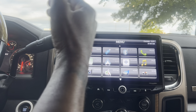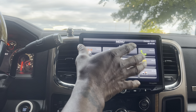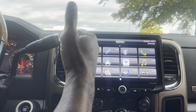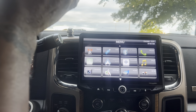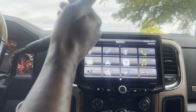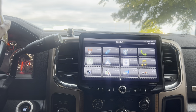So let's say, just for example, you had the crossover setting on your head unit at 150 hertz and under, but on your amplifier you have it set at 80 hertz and under. So you have 70 frequencies that you're not even going to hear — you're missing them and you don't even know it. Between 80 and 150, that's 70 frequencies your amplifier is cutting off, and it's just playing 80 and under.